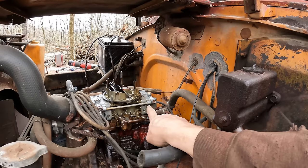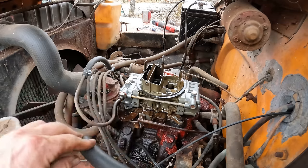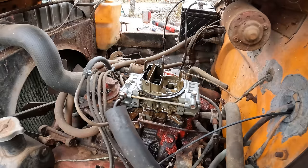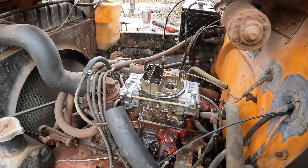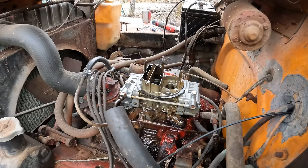So I'm gonna have to potentially pull that float back off and reseat that whole tube. Probably not the right thing to do, but I tried a Hail Mary. I could actually spin this tube and shoved it back that way in hopes that I was able to pick up that O-ring, but we'll give it another shot real quick. Nope. We don't need a whole bunch of fuel spraying around the engine bay here, so I guess I'm gonna have to pull that float off there and readdress this properly.